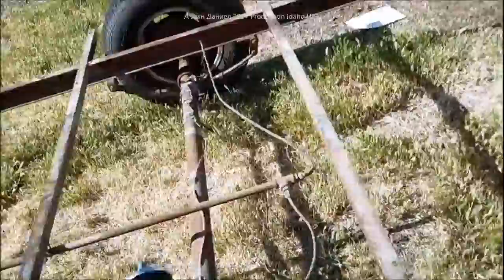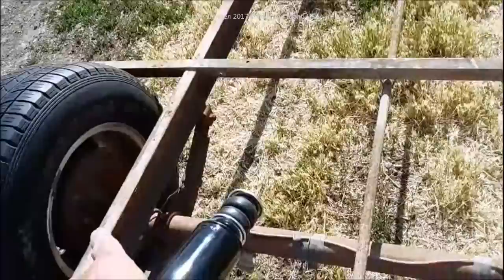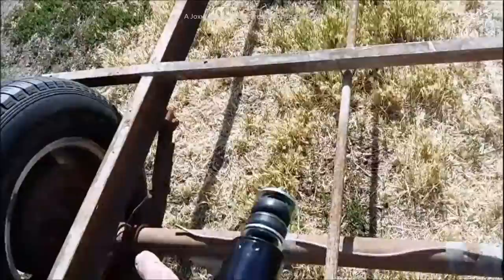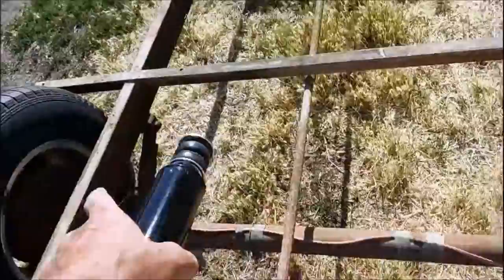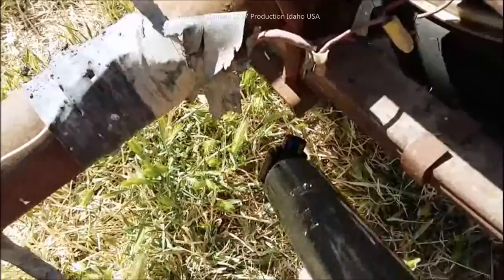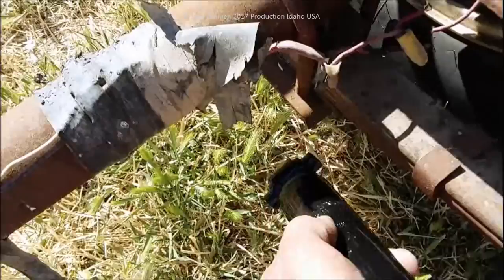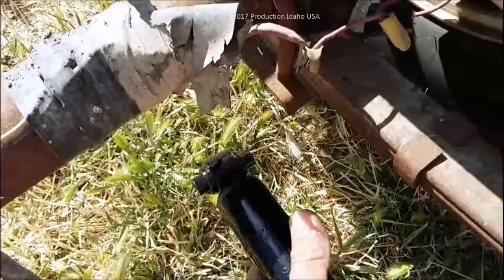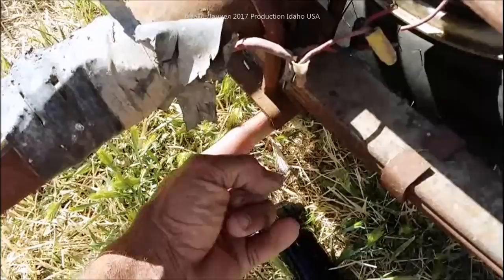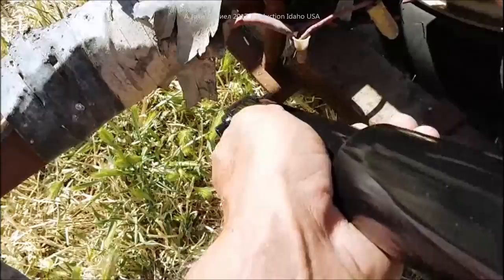Putting a set of shocks on one of these is not that hard — it's actually pretty easy. On this model, all the hardware from the travel trailer was still here, and this is pretty heavy steel: a quarter inch on the back long plate and three-sixteenths on the flange for the C-channel. On these 3,500 pound axles, at the bottom of the spring mount you can actually weld a bolt on just underneath there. The bottom of your shock won't be hit by road debris because your bolt heads are lower. You can weld a number eight bolt all the way across.